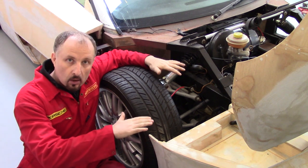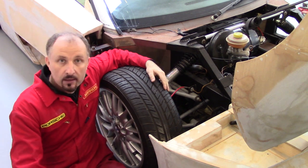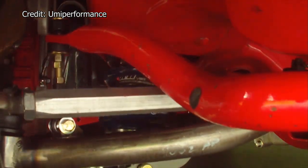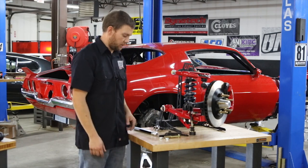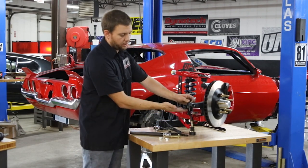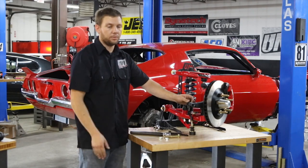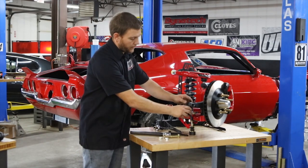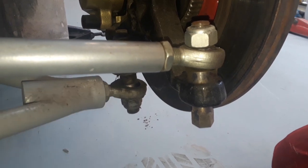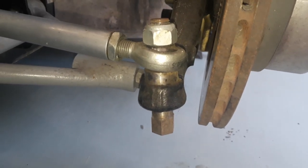One of the problems of raising or lowering the ride height on any car is that the steering arm can be turned up or down on a standard steering rack, and this can induce bump steer. Bump steer is defined as toe change during wheel travel — as you drive down the road and hit bumps, the wheels will toe in or out based on the angle of your tie-rod end. To adjust bump steer you tune the spacers to change the toe travel so that toe stays even throughout wheel travel. These are custom steering pins made out of very high-strength steel, and they can be adjusted so you should be able to tune out any bump steer if you raise or lower the car.